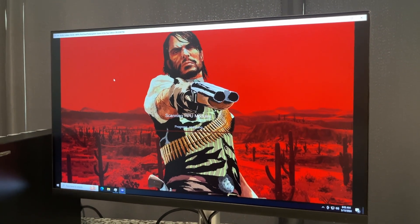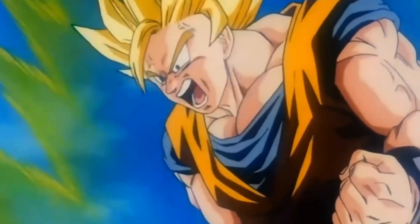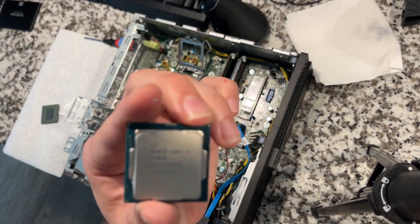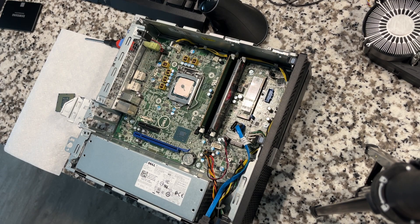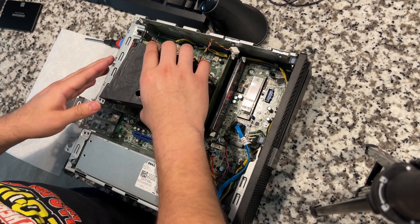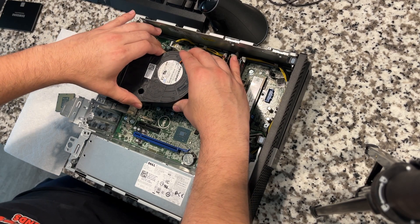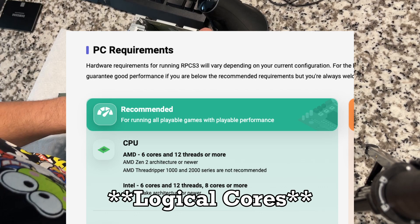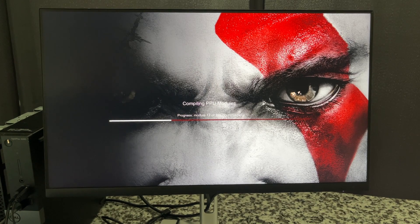At this point I decided there was only one thing I could do: load up Windows to see if the emulators there ran better with the current hardware. Without spoiling too much, they ran much, much better. But while it was still semi-playable depending on the game, I felt like there was something I could do to go even further beyond. Luckily, I had a spare i7-8700 laying around I could replace the current CPU with — an i5-8500 — which would give us a nice little boost. The main reason is the higher core and thread count of the 8700, which comes in at 6 cores and 12 threads, a whopping 6-thread improvement over the old CPU. PS3 emulation is different in that it absolutely will take advantage of the higher number of cores. So I finished swapping out the CPU, then loaded up all the games and emulators I was going to test.